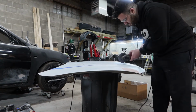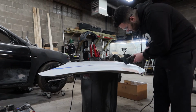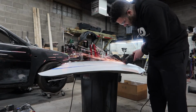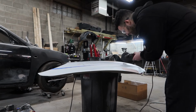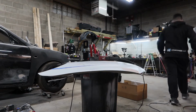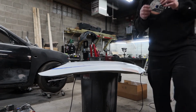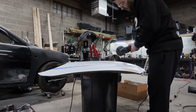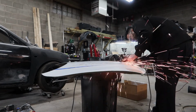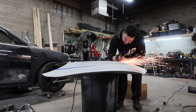So in order to get the hood vents centered, you obviously have to use a reference point on the hood. Some people have to create their own reference points by measuring the exact center of the hood and working based on that. In our case, in most hoods' cases actually, there are wiper nozzles from the factory, so we know that the wiper nozzles are centered, and because they're made by a robot you know that they're accurate. Along with that, there are body lines that run along the side of the hood, so using those and the wiper nozzles, we created two reference points and measured each hood vent relative to the position of those, and that's how we made sure that the hood vents were centered and not offset. We also made sure that they were an equal distance from each other as well, and they came out great. Very happy with them, but I won't show them until the car is completed.